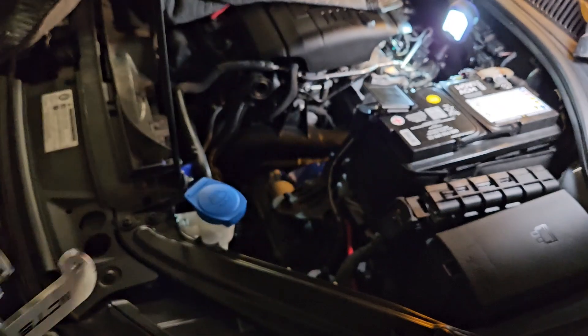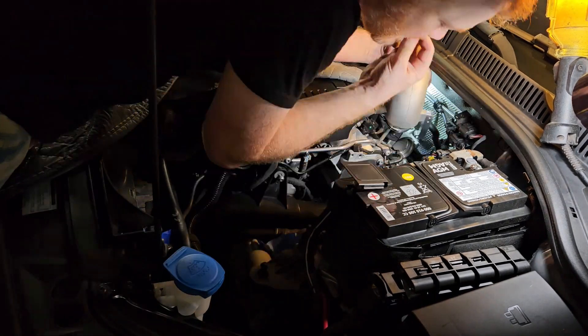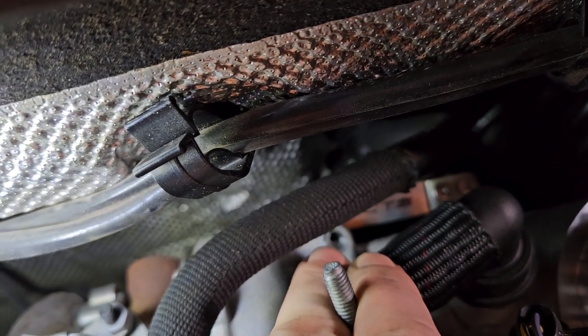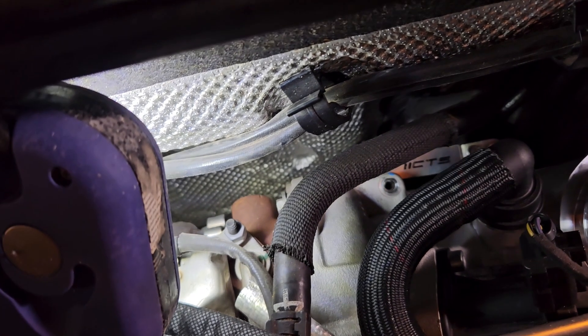Does it actually do anything for us? I don't know, but we're going to find out. It's fortunate that this screw was good hard steel, because if you look down inside here, that screw hole is off a little — it's actually kind of to the side, off center. I'm going to try to put tension on it and get it to line up. Either it was cross-threaded to begin with or I cross-threaded it slightly — so I had to take the whole thing out, put the bolt in from the back side, and re-thread it. Folks, this is something to look out for.